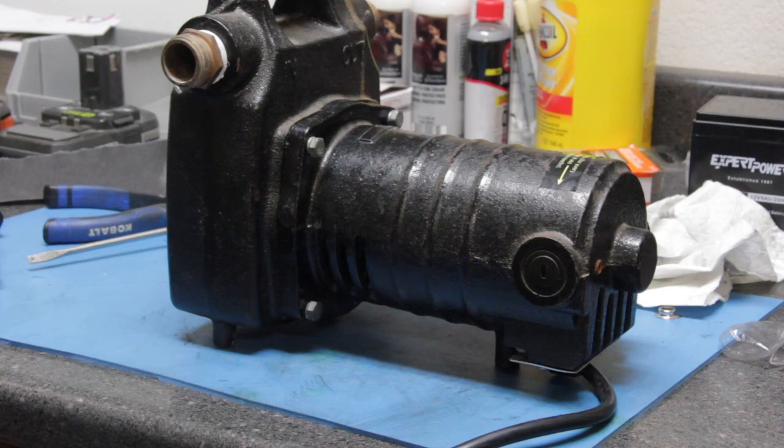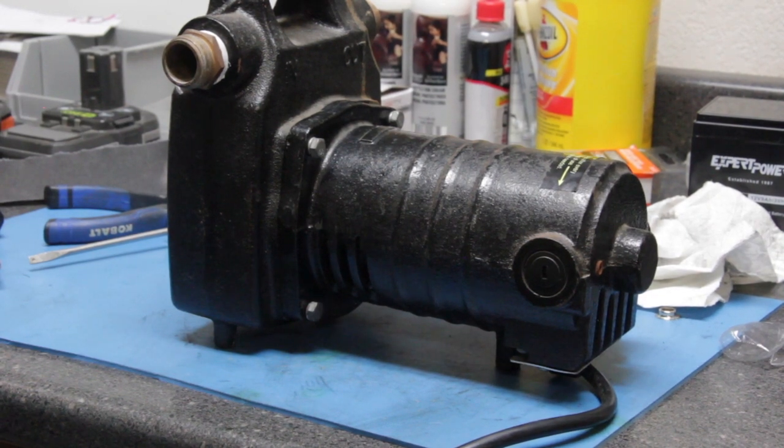We have the new brushes in. Let's go ahead and fire up the motor. It looks like the brushes were the problem. I'm going to go in and see if I can take a screwdriver and gently move that other brush holder back a little bit, because the brushes on one side are extending further down than the brush holder on the other side. But that was the problem — the brushes were the problem. I wanted to show you a proper way to troubleshoot both the armature and the field windings. I hope you enjoyed this video and we'll see you next time.